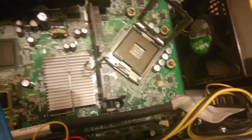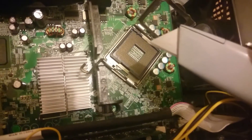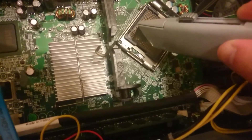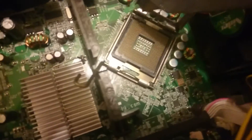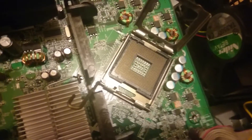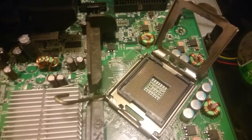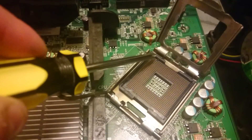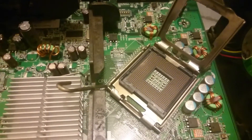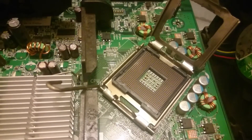So what we're actually going to have to do is get a Stanley knife and chop off these little notches — there's one at each side. I'm just going to do that off camera because this could get quite messy. As you can see, here and here I've now cut off the notches, so the Xeon processor is now going to fit.